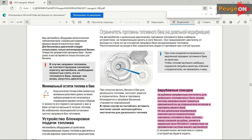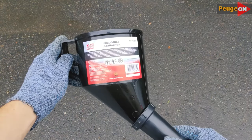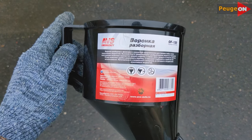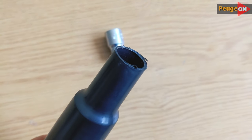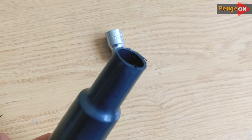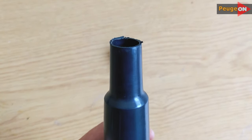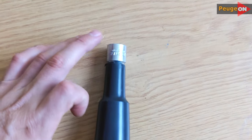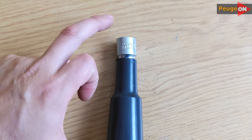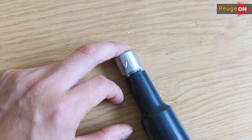Anyway, let's get back to what I did. I decided to keep it simple — I bought an inexpensive collapsible funnel, simply because it costs around four or five dollars. This funnel has a spout with a diameter of 21mm, and we need to make it 25mm for diesel. So we take a metal object — specifically I took a 14mm socket head. Then we heat the tip of the funnel either on gas or with a hairdryer.